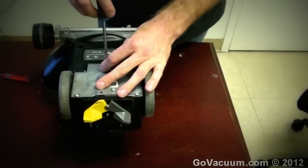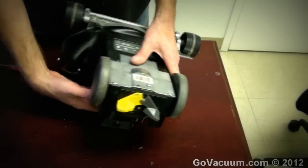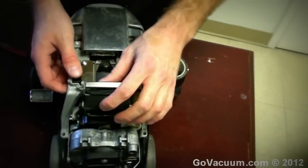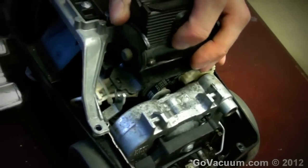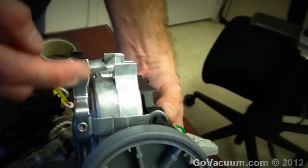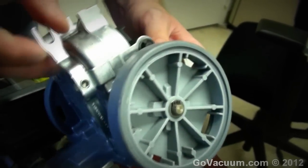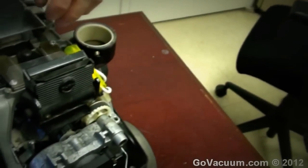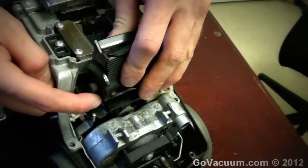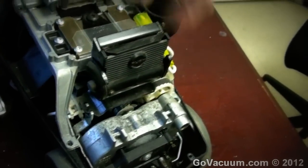The transmission is now fully back on and engaged. We need to put the cover back on, but first connect the handle bail. Looking at the transmission, we see this little arm that rocks back and forth — once connected to the handle, that's what engages forward and backward drive. Connect the handle bail right there. This is the newer style handle bail; if you have a Kirby Generation 3 it used to be a pin that sat inside here.